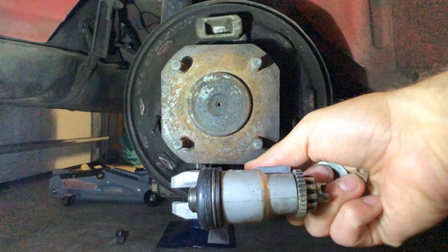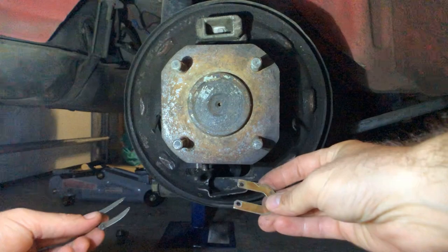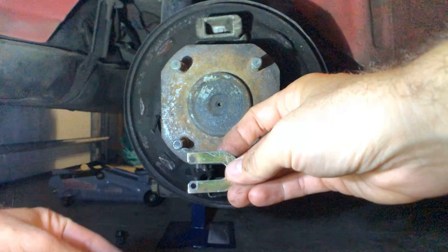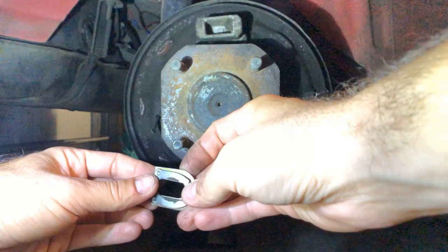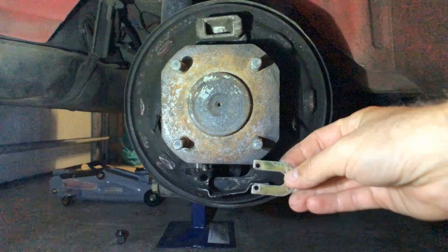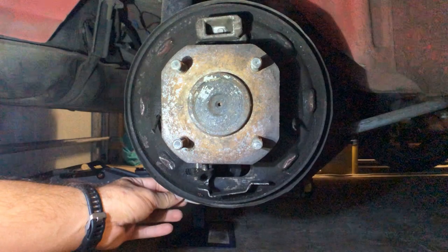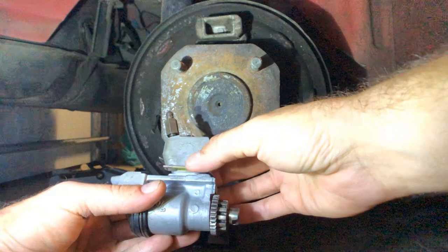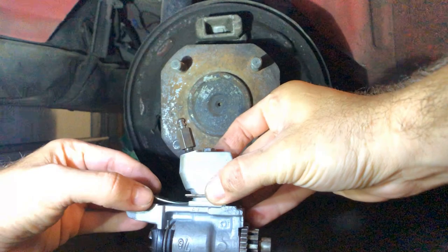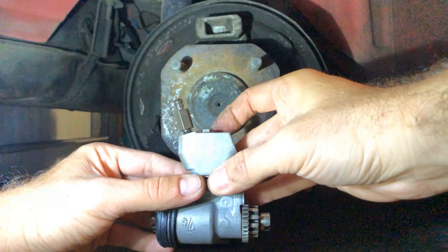The first thing to do is take our rear drum cylinder, which sits in there looped around the handbrake bracket, and install it with these sliding shims. You can see there's little divots here and these corresponding little holes there. The idea is that they sit in this orientation. General rule of thumb is this big U-shape one comes in from the adjuster nut end. And this expander bracket's expanding U-shape one sits in between the big U and the backing plate. These go on behind up the back here and they slot in — this one fits in there.